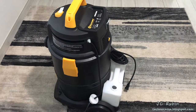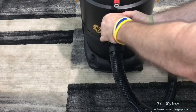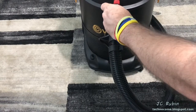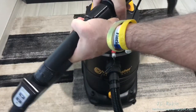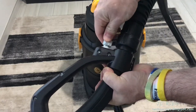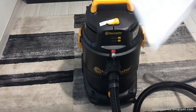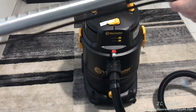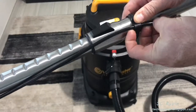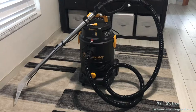We'll reintroduce the detergent tank and put the connecting hose back onto the cap. The suction hose is screwed onto the front of the unit. The detergent delivery tube is then snapped into the fitting. The remote control handle is locked onto the suction hose — it is keyed. The detergent delivery tube is locked onto the remote control handle — also keyed. The telescopic tube is affixed to the remote control handle, and I'm placing the larger carpet lance on the telescopic tube as a press fit. Then I bring the hose through the guide and connect it to the remote handle. That concludes unboxing and assembly.